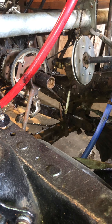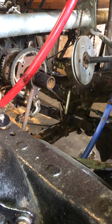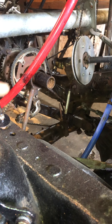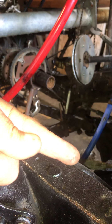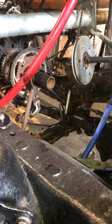These bright red tubes right here are part of the water drive control system. I use PEX tubing like super-sized bike cable — inside this red tubing is actually a steel cable which does the work, and the tube is just there like brake cables or shifter cables, just super-sized. This blue one right here is the engage and disengage for the front wheel drive — right now it's locked in four-wheel drive.